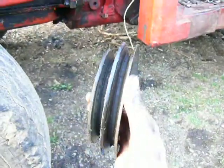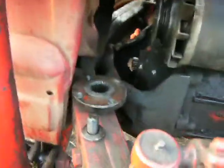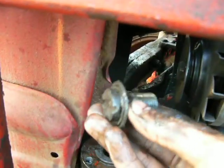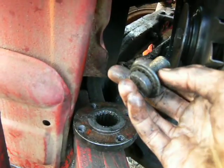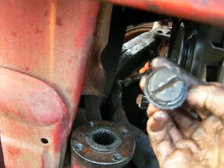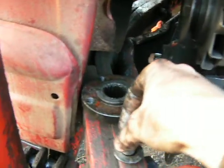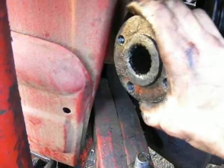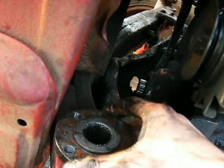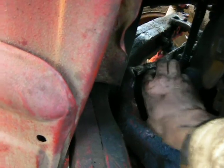After I loosened up the belt, it came off the pulley. There was this bolt — a very fine-thread short bolt with a flat head slot in it and no hex flats, go figure, I don't know why — and that was holding on this splined hub, which slides onto the splined crankshaft end, right in there. It goes on just like so.